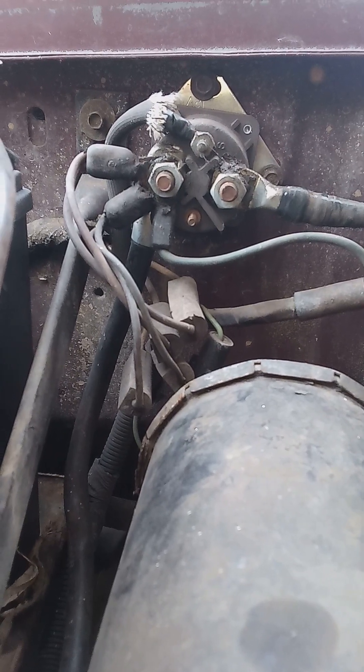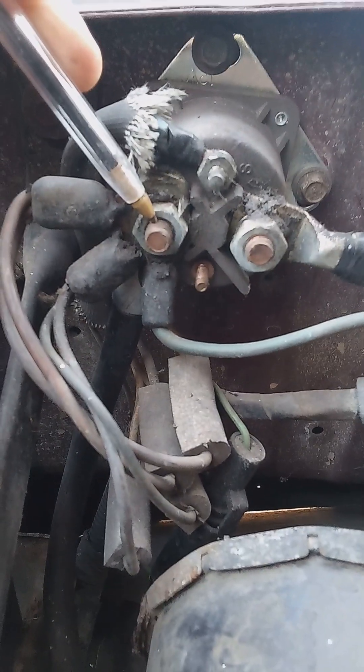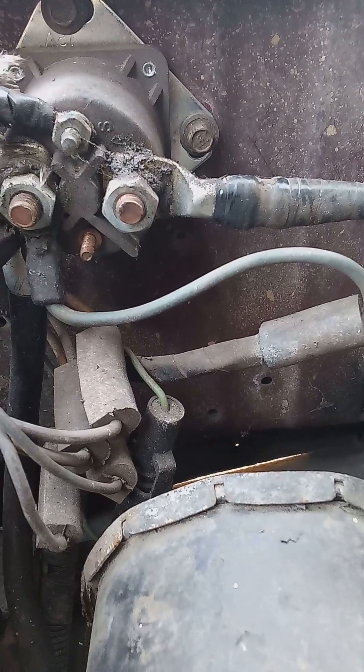let's just think of electricity as water. So you have 12 volts coming from the positive terminal on your battery, and it's flowing through this wire right here, flowing to right here where my pen is. So it comes from the positive terminal — I've made this cable up so it's a little long, left myself some extra slack — and it ends right here, connected to this stud right here on this starter solenoid relay. So 12 volts is right here where my pen is touching right now. These other wires also are receiving that same 12 volts.